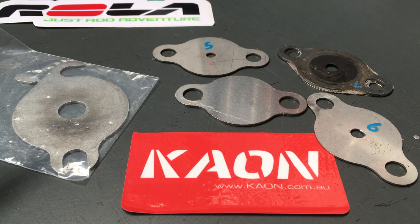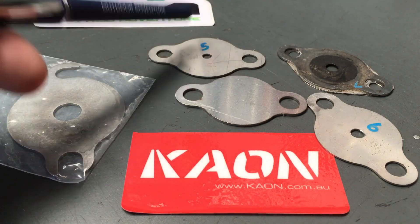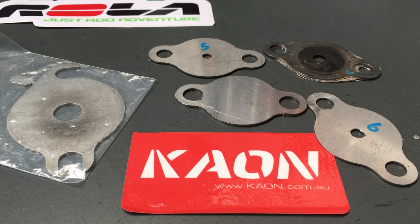A 5mm or 6mm might work for some vehicles the same way 13mm works for the 1GD. But 7mm is where it started and works on most vehicles — we know a lot of people who put the 7mm plate in and it works. It's kind of snowballed; it's the done thing now. You buy it from eBay — Kaon 4x4 is their eBay name. The 7mm plate stays in there securely once installed, though it's not easy to get in — you've got to undo both ends of the EGR cooler and the mounting bolt.